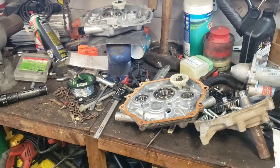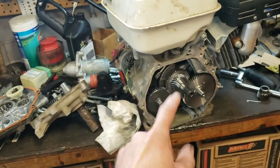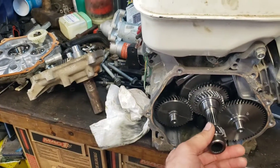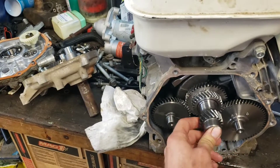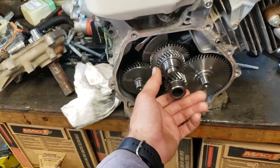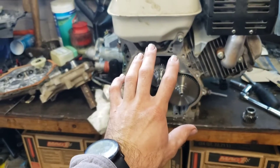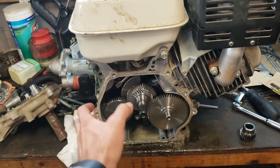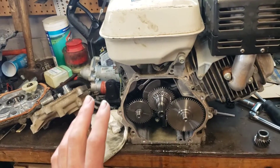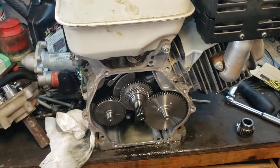I'll put that bearing number in the description if I remember. So what we're going to do is knock out the new bearing and put in a bearing that has the correct size for this crankshaft. Then the only thing left is figuring out how to adapt the splined crankshaft - I didn't find a splined adapter yet but I'll do some more looking. We need a way to adapt the splined shaft to the sprocket that we're going to use on the log splitter. For now I'm just going to make sure the rest of the cover fits - we'll have too large a hole in the bearing but we want to confirm everything else lines up. If it checks out, I'll get the bearing ordered, put it in, seal things up, and then it's just a matter of adapting to our sprocket. Stay tuned.